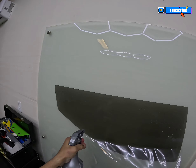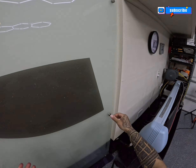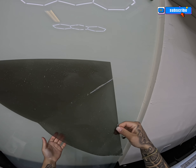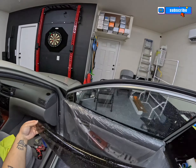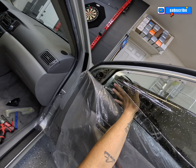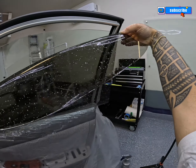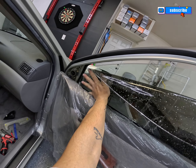Mist the glass and then take your liner off and spray a lot of soapy water on your actual film. When grabbing the film, pay attention to where my fingers are placed — you want to grab it the same way I do. This is going to be the easiest way for beginners on installation. You're going to want to install the side that's closest to the windshield first, and then hold it at an angle just like I am in this video.